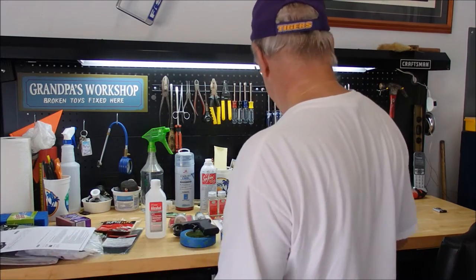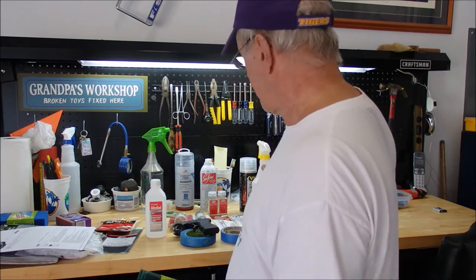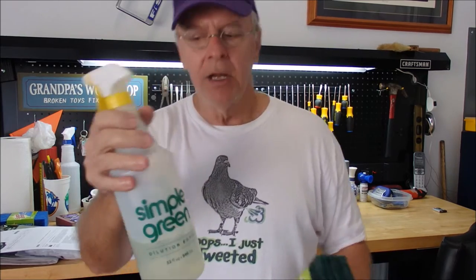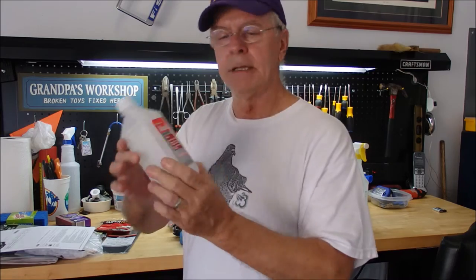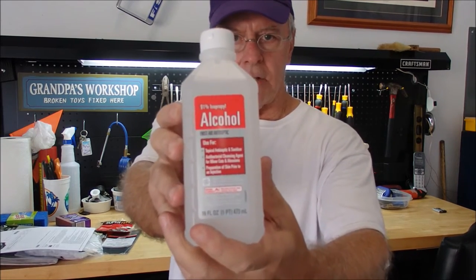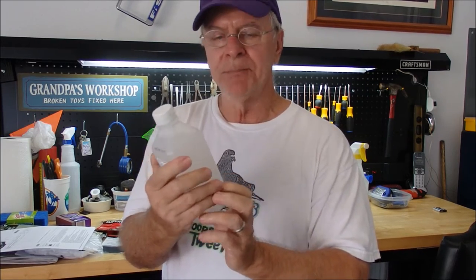The last few steps have to do with wet sanding, polishing, and wet sanding. I'm not really good at that, so if by the time I've done the first six steps and I'm happy, I might just stop right there. First, take your coil covers to the side of the house where your hose is, scrub them with Scotch-Brite or heavy-duty scouring pads. I like to use Simple Green — it's biodegradable and cleans very well. Then come back with 91% rubbing alcohol and wipe down your coil covers and engine cover. I got this at Walmart for about a dollar. Let those dry.